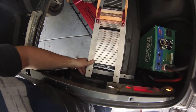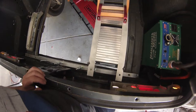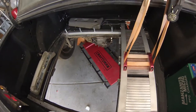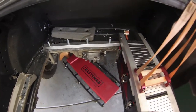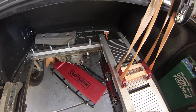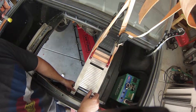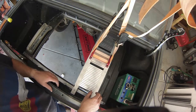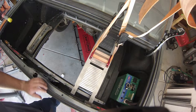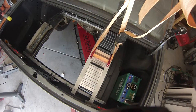You can see there are two studs going along the back — that's where the modules fit in. It'll sit against those studs, and that's what will align everything up. Up front, the bolts go into the threaded inserts we have up here for the front rack. So I've just lined up the four bolts: two studs in the rear, two bolt holes in the front. Lowering it down nice and slow.